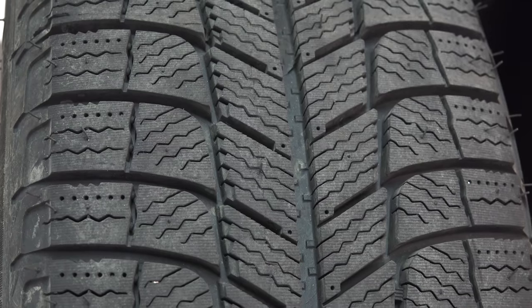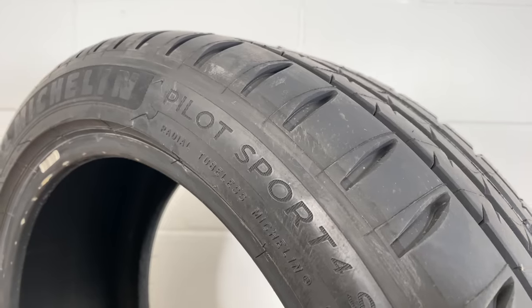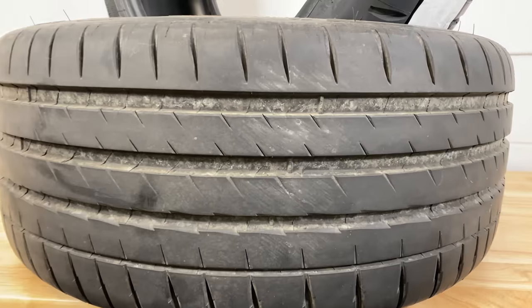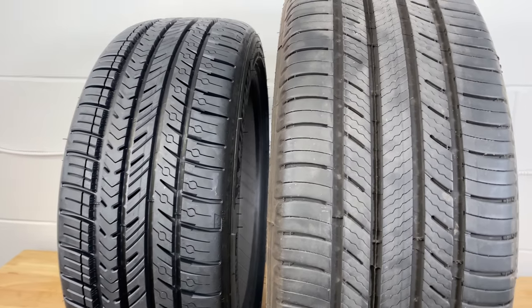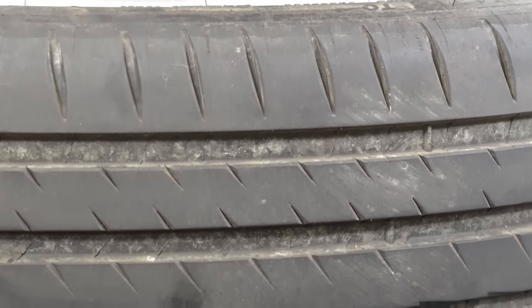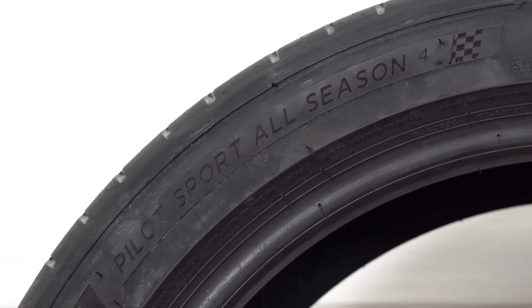So what's the overall strategy? On one hand, you can have a winter tire — great in deep snow and ice, but not as great at dry or wet braking in higher temperatures, nor great for dry handling. On the other hand, a summer tire offers excellent dry and wet performance and great handling when temperatures are nice, but you don't want to drive on these in snowy, icy, or even really cold conditions. In the middle, all-season tires are generally very good for tire wear and provide good year-round traction for many regions — a decent compromise, while offering long tread life, which is nice for consumers. For areas that never see snow or have well-managed plowing, you can get away with it.